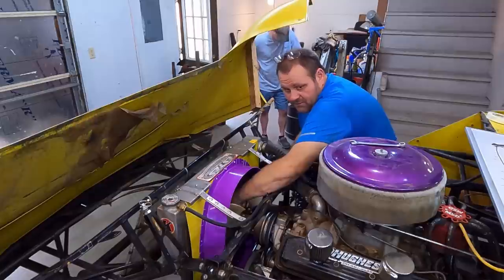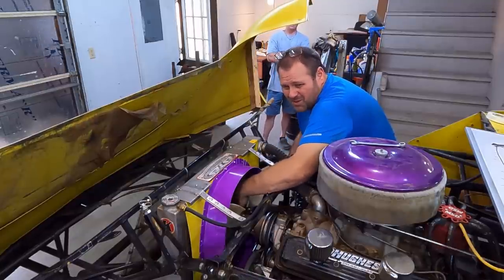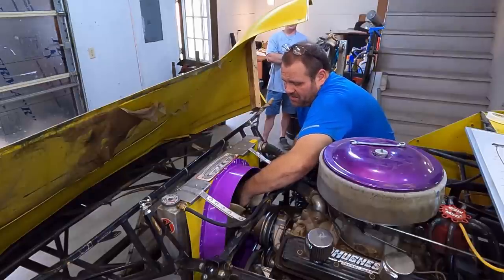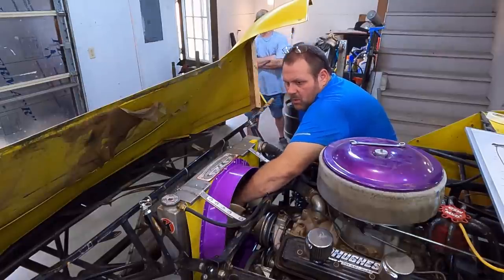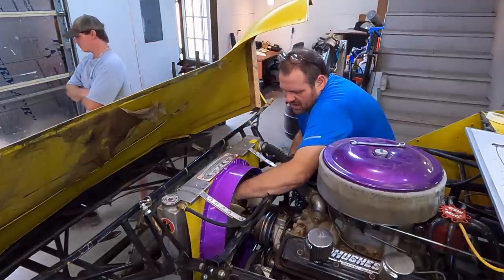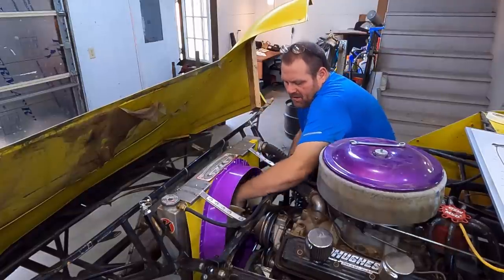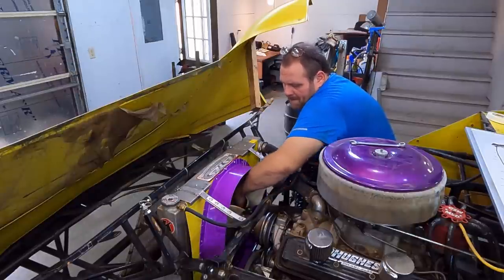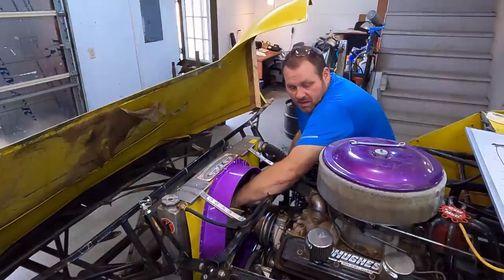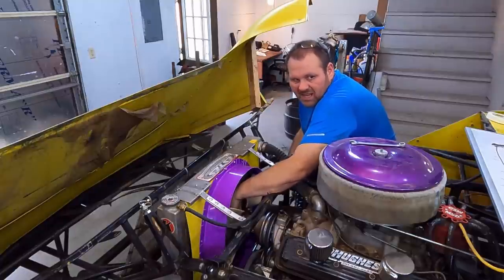I would tell Dylan starting out, leave four blades on it. Especially with it only a 17 inch fan. Mine boys are going two blades and three blades, that's a 19 inch fan they're doing that. Yeah. We started out with three and then went to four. But it didn't really help. Yeah, that makes sense that it wouldn't though, considering the situation. All right. We're hoping to run maybe four blades in the summertime and as the temperatures get cooler, get down to three maybe, or two if you have to. It ain't even taking off a lot of weight at three or two. It's not the weight, it's the horsepower it pulls.